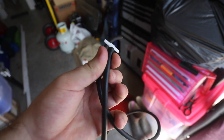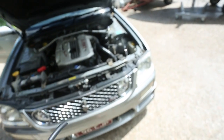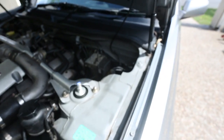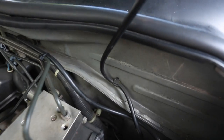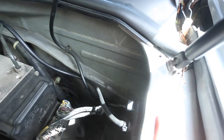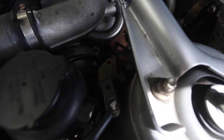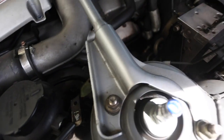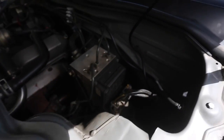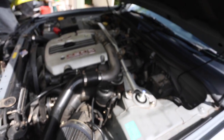I'm going to try using this 3mm line with a 3mm tee piece. The other line that we have to tee into is 4mm — that's the line here that runs to the boost gauge sensor. We're going to run it down to here where we're going to mount the EVC sensor. There should be enough line and it should get an accurate reading even with 4mm line and a 3mm piece, so we'll see.